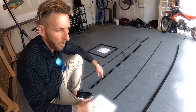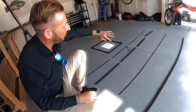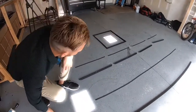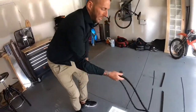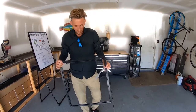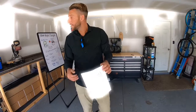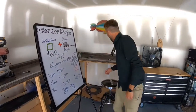For example, we'll use our most popular measurement: 21 by 23 inches, which fits all Beverage Air refrigerators. You can cut four pieces from that eight-footer to make one complete gasket — two 23-inch pieces and two 21-inch pieces — plus the magnet that goes into those pieces. Using the Eco Gaskets welding machine, it takes about five minutes to make this gasket. I can do about 12 gaskets an hour, with a total cost of four dollars and fifty cents.